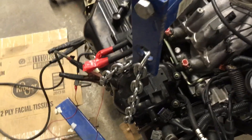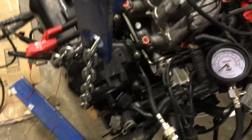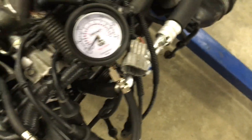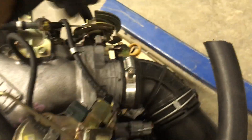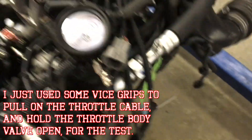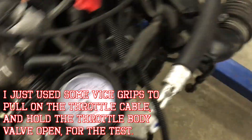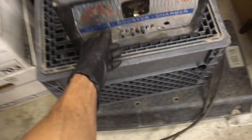This is a retest since this engine appears to have low and erratic pressure in a handful of the cylinders. We're going to redo this just to make sure we're not wrong. Making sure the throttle cable is pulled tight so we know the throttle's open. Cylinder number one zeroed out. Just kick off the power — we need to plug it in. Safety precautions.